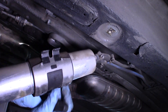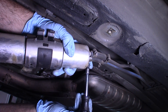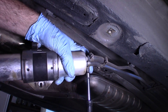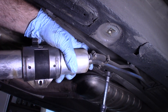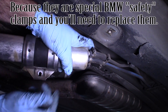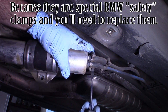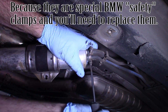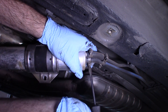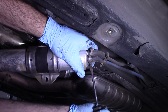I cannot see what I'm doing. This line on the outside, by the way, is the input line. This is the return line. Why is it smaller than a six, BMW? Or why is it smaller than a six? I don't know. I was thinking to myself that these things are kind of deteriorated, but they're not — they're purposely sort of made like this. There must be a special tool that BMW likes to use for these.